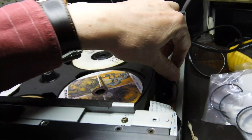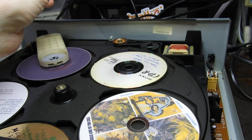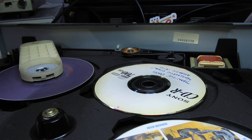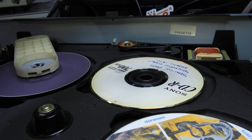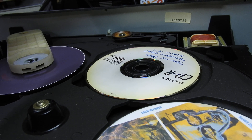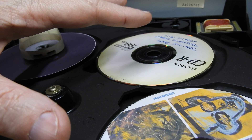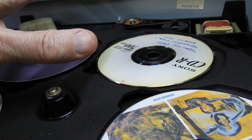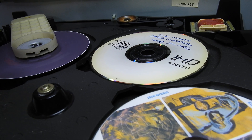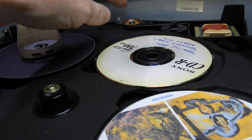A lot of cleaning of course. The belt had to be replaced because a rubber band is not really fit for purpose, and I was struggling to find the right belt because I had no idea what was there before. I tried first two square millimeter belts — that didn't work. Then I went for 1.4mm, and the tray just would not quite engage — sometimes it would, sometimes it wouldn't. I went from 49 to 46 size and it made no difference.